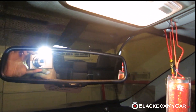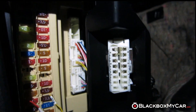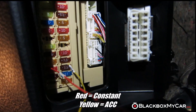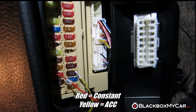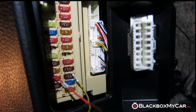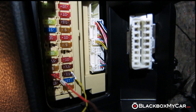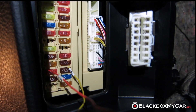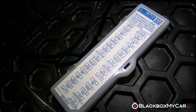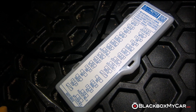From the driver's seat, you can't really see the camera at all — you just see the two wires. To give you an idea of the fuses we use: the BlackSys actually has the fuses in reverse from the Power Magic Pro. The red fuse is the battery fuse, whereas the yellow fuse is the ACC fuse. On Toyota vehicles and a lot of other Japanese vehicles, the ACC is really easy — we use the dedicated ACC fuse. From the bottom right, that's the 7.5 amp ACC fuse, the one we use for ACC.